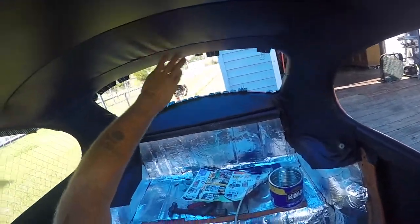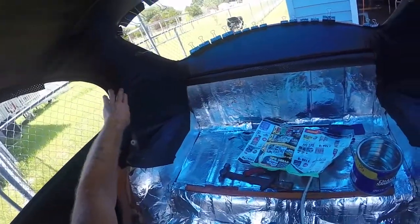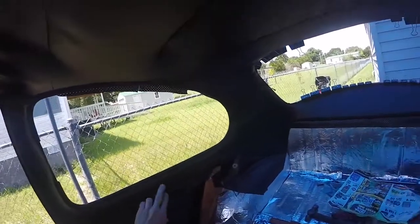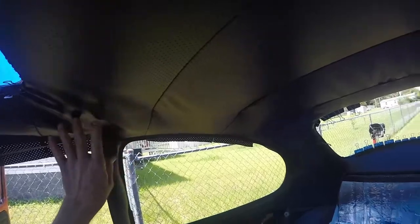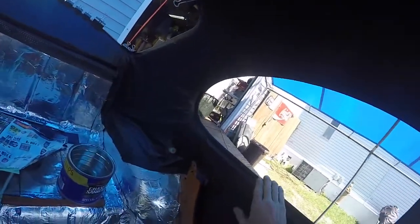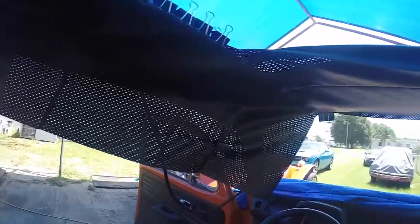I'm well past the stitching and I'm taking out the white piece for the bow. Some of these creases — after the sun bakes the car a lot of this is going to go away. The sunroof is going to take out some too. There might end up being a wrinkle or two over here, but overall I'm pretty happy with it. See how my folds are here over the perforated material — it's nice and tight. I already have the seal in for the pop-out windows and I'm going to install them, then the rear window, and work my way around the sunroof.